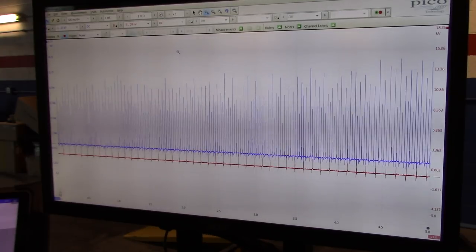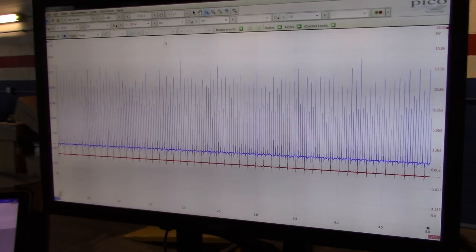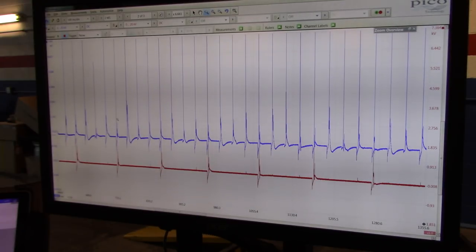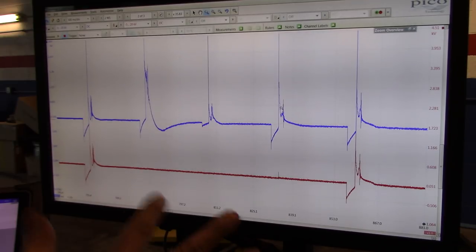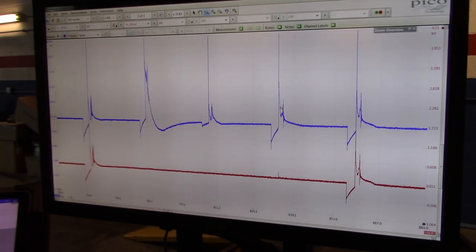Zooming in more — definitely numbers three and two are giving weird readings. Looking at the firing order 1-3-4-2, we can put the sync down now that we know cylinder positions. Even the burn time on some cylinders looks very high compared to others. I don't even like how number one looks. Moving to the next screen — on the second frame, number three is definitely the issue. You can see it clearly here — number two is kind of normal-looking but number three is up high. We have an issue here either with a coil or with a spark plug.